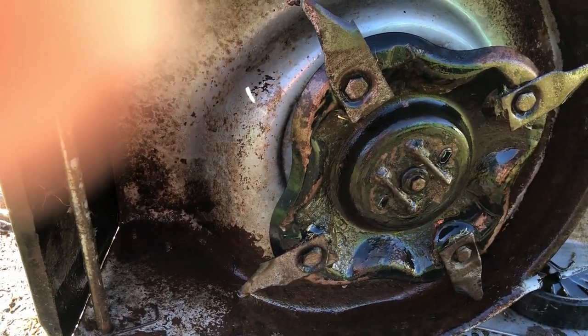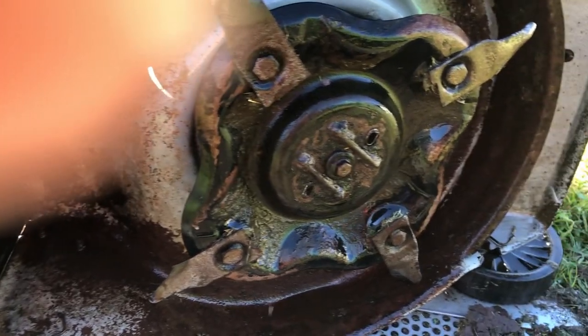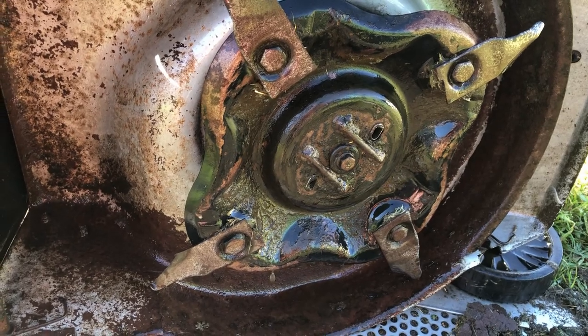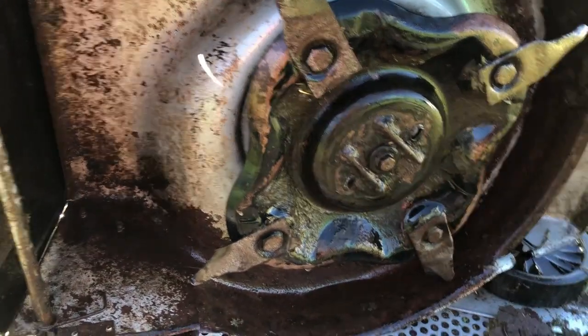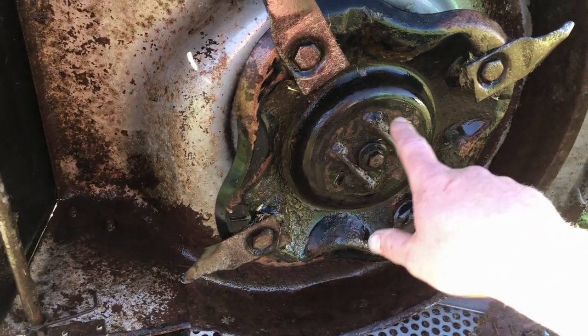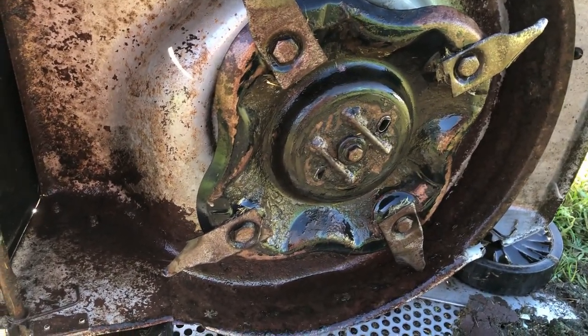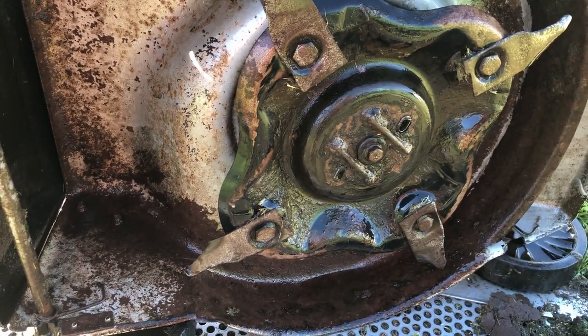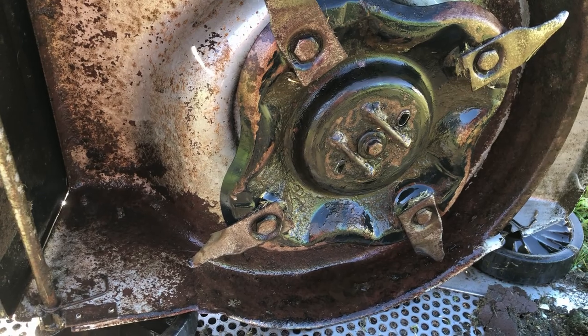About to come back down and start changing these blades. I found something quite, I wouldn't call it outright dangerous, but these blade plates on the Massports have a habit of failing. They crack around where the blade boss is. And someone here has just welded bits of rod across these cracks. That's not the way you do things, you just replace it.